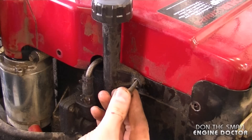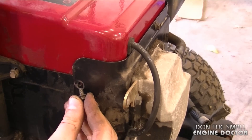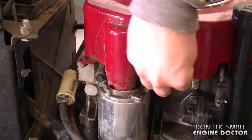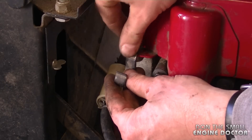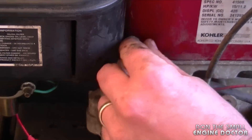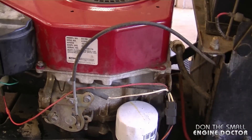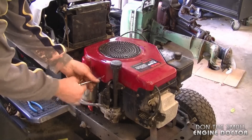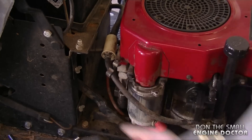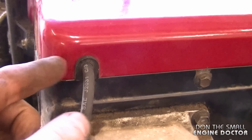Remember that the longer bolt holds the dipstick tube, and there's also a short bolt that goes over here, and one that goes over here. Don't forget to reattach the clip for this bolt. As I mentioned earlier, the bolt over here is broken inside the threads so I'm just going to leave it and go around tightening up all the bolts. Don't forget to insert the fuel line in the clip, and when you're done make sure the grommet for the spark plug wire is in position to protect the wire from the metal.